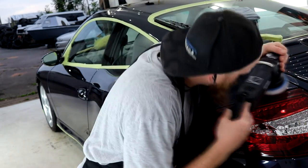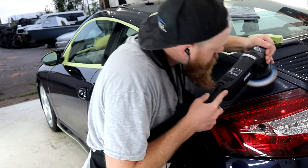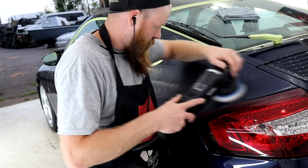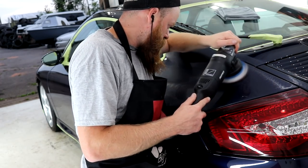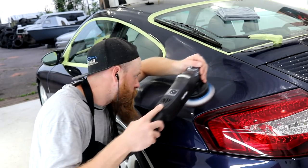The harder the paint, then the more pressure I generally put down, but just remember it isn't always a simple case of using a heavier cutting compound because we still need to refine any self-induced marks. Believe me, if you don't leave some type of self-induced marks after the compounding stage, then the chances are you haven't offered the paintwork a good enough cut.